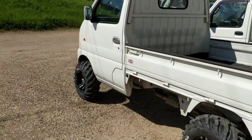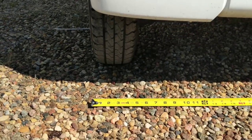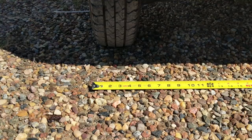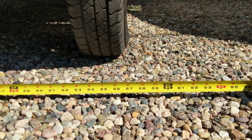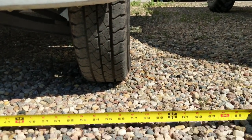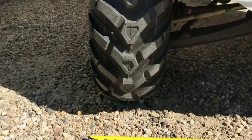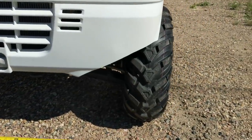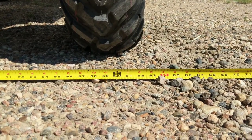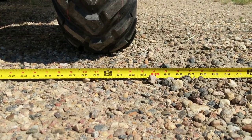The other thing we'll show you is the width, so let's measure that up. Going to the outside edge of the front tire — you've got some body trimmings and mirrors that might hang off a little wider, but the difference in width is going to come in at the tires. The stock unit comes in at 57 inches wide at the outside of the front tires. On the modified truck we can call that about 62 to 62 and a half inches.